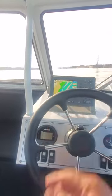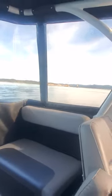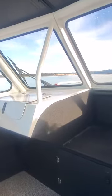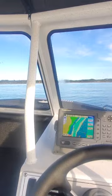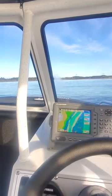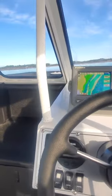There's six, so we get about seven. We'll flip this around, bring it back up, turn it off, then trim it up. Hit the key for the main, give it some gas. About two and a half seconds to plane. We need to drop the pitch down to either a 14 by 15, or we can go to a 15-diameter by 13-pitch. About two and a half seconds — it gets up pretty good.